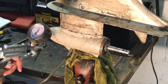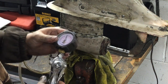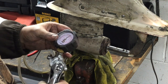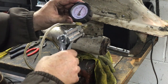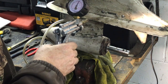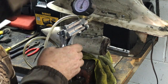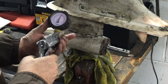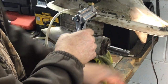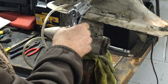That's tight. Let's see what we get. Seven pounds... about ten, a little over ten, for ten seconds. This still passes the test. If I spin this it may drop a little more, but this is where the seal is — that was bad before. It's gone to nine pounds now, but it's been holding for at least ten seconds, so it passes. If I turn the prop shaft, nothing happens. I say that passes.